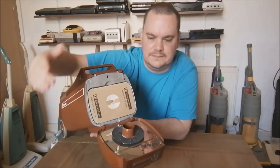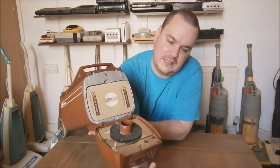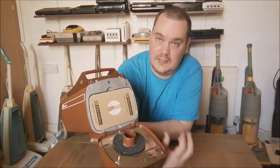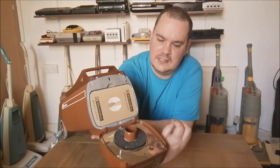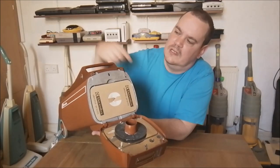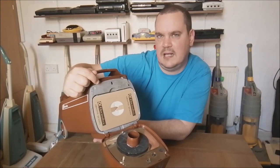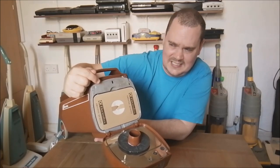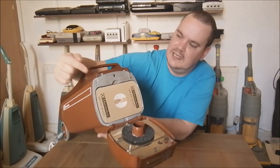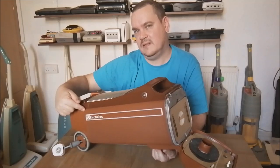That's very clever. But what happens here is when this pressure mechanism is fired, when the pressure in the bag chamber reaches a certain point, it basically unlocks, it kind of flicks itself open. Now you see here, there's a little metal piece sticking out, and you can push that back and forth. It's under quite a lot of pressure. If you did that a few times, it would hurt your finger. Now this rod runs all the way along here to the back of the cleaner.